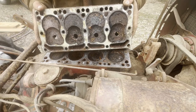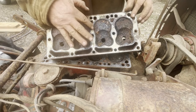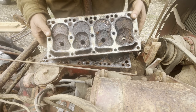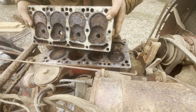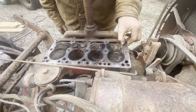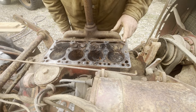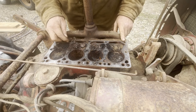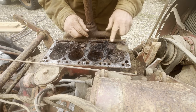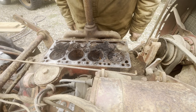And there we have it — a lot of rust. Things are in bad shape. That still doesn't answer why the fuel is going into the water jacket, as the gasket seems to be fine. We've got some warped valves by the look of it. I'm going to get the air gun and blow this mess off and just see exactly what we've got going on in there.